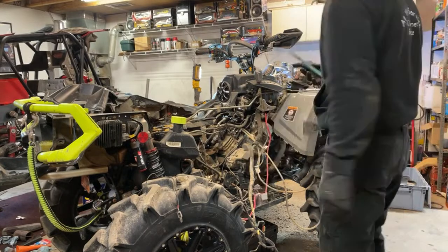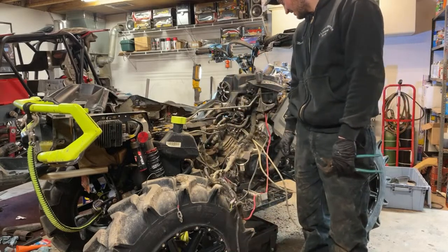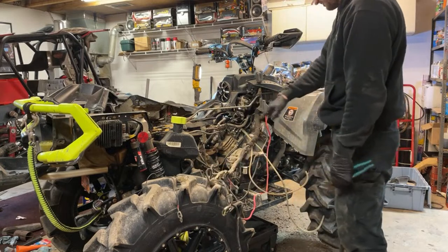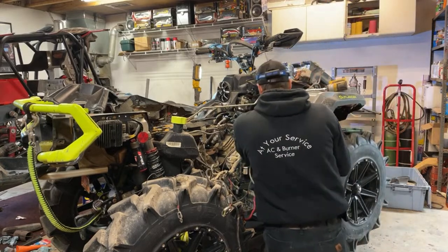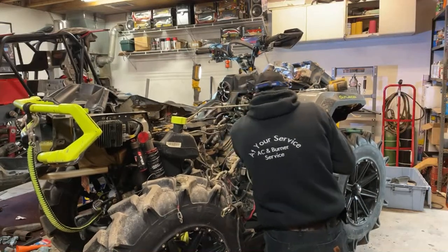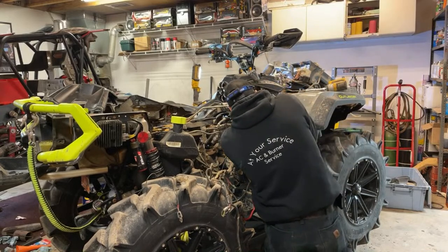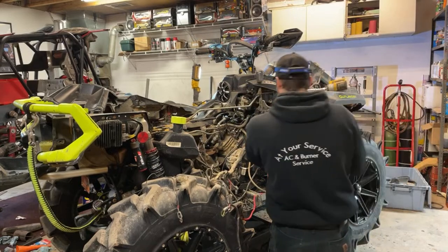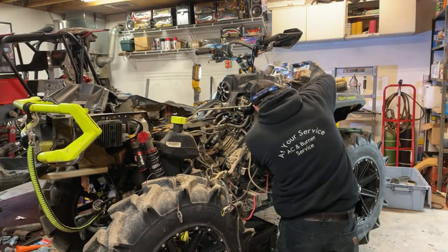As you can probably tell by the title, all this has to come out of the 650, and yeah, it's not gonna be fun, but I got everything unhooked actually. I just have to pop off the PCV breather. This is where you get your oil in your air box, for those who are wondering, when they get a little sideways in the mud hole or something. But the harness is right behind it, naturally. I'm gonna see if I can rotate it enough to get under the clamp, because I can just pop the harness out the whole side here.